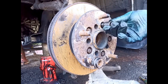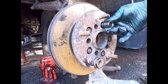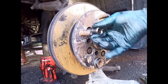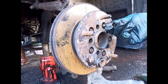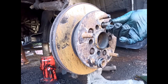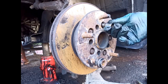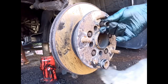This is a 13mm. I don't really see that. There's a tiny bit of turn, a little bit of play. If they weren't so vital, you'd probably manage that. Now it pays to try another 13mm socket. Once again, tiny weeny bit of movement. Now, a half inch is 12.7, so that 0.3 makes all the difference. And you can see I can't quite get it on. So that's as good as it gets.